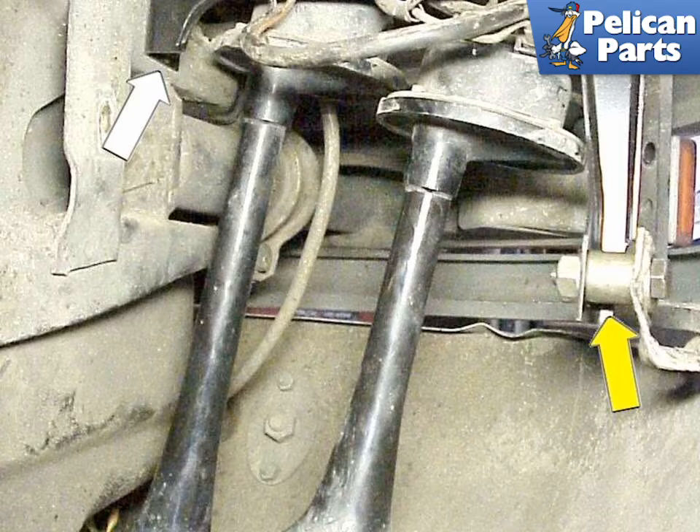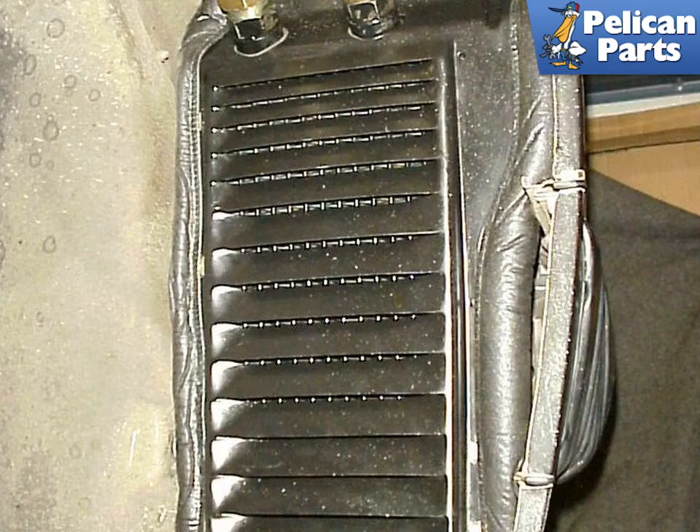The relocation of the horns is the trickiest part of the project. A new hole must be drilled in a very tight space for the fender strut to be mounted to the inside of the car. This hole can be drilled in the sheet metal support that is welded to the inside of the fender well. It is possible to reach behind this area to place a nut on the mounting bolt.